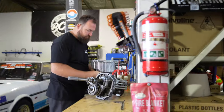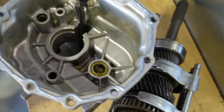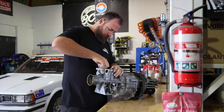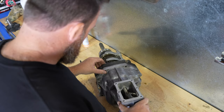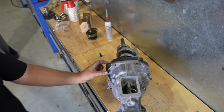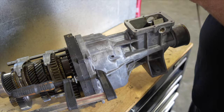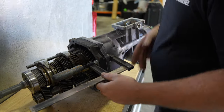I wanted to put grease in that back bearing because it's been washed — only because it's probably going to run dry for a bit when the box gets put back in the car. I might even put a bit of grease on that. It's got dowel pins, or sleeves actually, that locate that case. I'm just going to do a couple of D-clamps to just nip that up, get it snug. You've got to do it in stages, because otherwise you're just going to pull it and it won't be square. That's in its happy place.